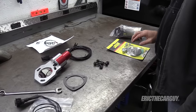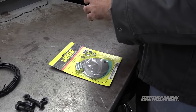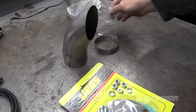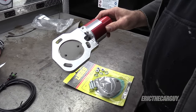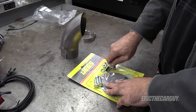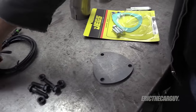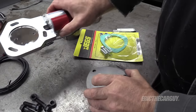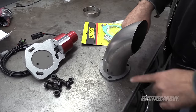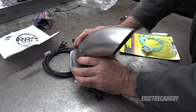We also have a gasket. For my turn-down - I want to basically shoot the exhaust towards the ground - I couldn't find a turn-down that would just bolt onto a three-bolt flange like this. So I had to get creative, like we often do when building custom cars. What I'm going to do is take this blank plate that can cover the hole, cut a hole in it with my plasma cutter to match up, then weld this turn-down onto the plate. So: cut the hole, put the pipe on, weld it together, and that way I'll have a flange I can just bolt on for my turn-down.